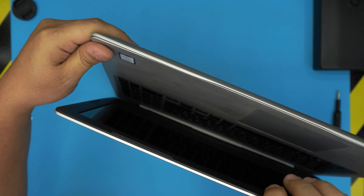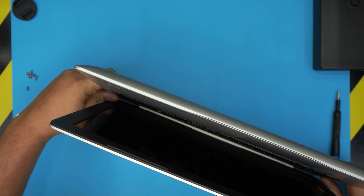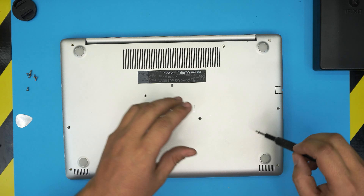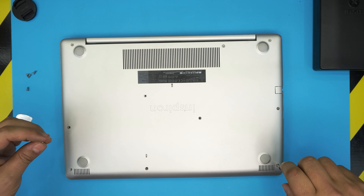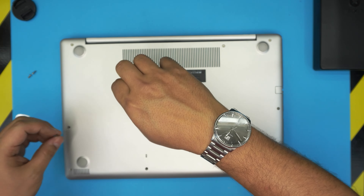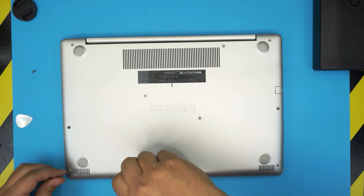This RAM I'm putting in is a 4GB stick I had lying around. Before putting the cover back on, you can power on to test it — that way you don't have to screw and unscrew repeatedly. Sometimes when you put in new RAM, you won't get anything on screen right away — don't panic, it's normal because the motherboard is doing a RAM check. Wait 5 to 15 seconds. If you still get nothing, power off, remove both sticks, put the new RAM in DIMM slot A only, power on and wait. Once you get a display, power off, add the second stick to slot B, then power on again. This often happens with laptops when mixing RAM.